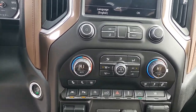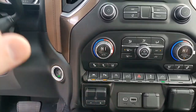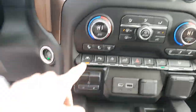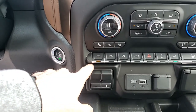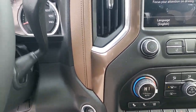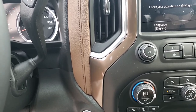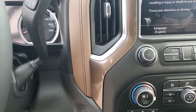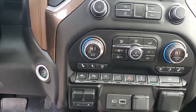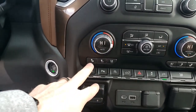This is for your parking sensors — those little things in your bumpers. Orange lights mean things are on; when you press that button, park assist is off. This is lane keep assist and lane departure warning. When you're driving there will be a little symbol — if you're green you're good, yellow means you're probably drifting out of a lane, and red means it's going to pull you back within your lane. If you're drifting it does work, so that's what that's for.